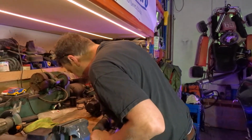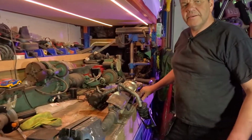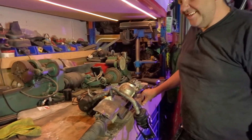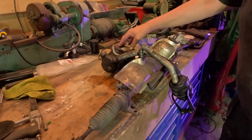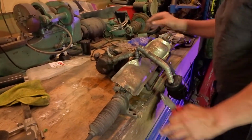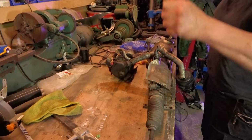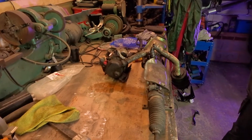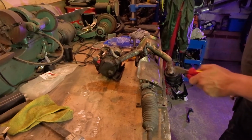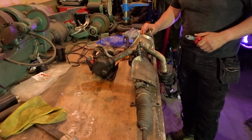Right, so cut the boot off then, shall we? Now, start again, because I wasn't listening. This is a steering rack. Hydraulic, with an electric motor which pumps hydraulic fluid around, and that gives you power steering. It looks quite small. But obviously we're going to clean it all up and take all these off, because they've got banjo bolts here.